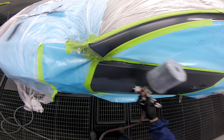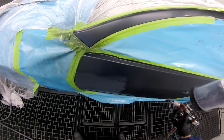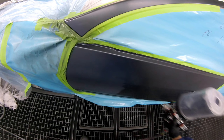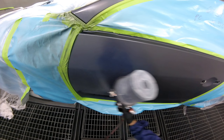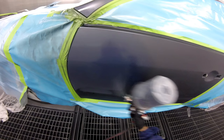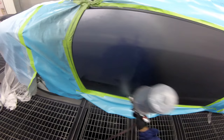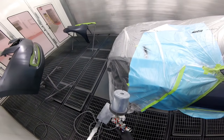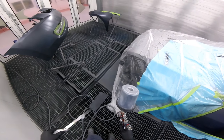There's a very important thing I'm doing here. You see how I am pointing my gun towards the fender? I post once a week and in almost every video I say: shoot towards the repair, paint towards the repair. This is a very good tip. If you just get this one thing out of this video, you will be much better off. By spraying towards the repair, you're containing that color and you won't screw up your blend panel.